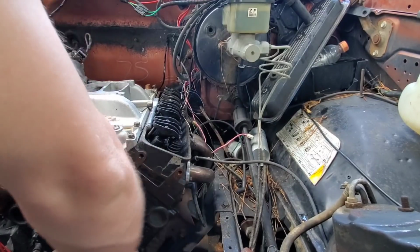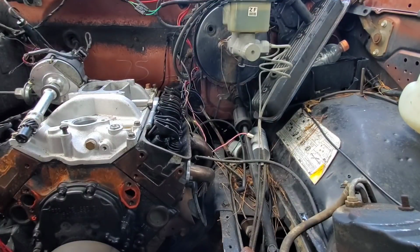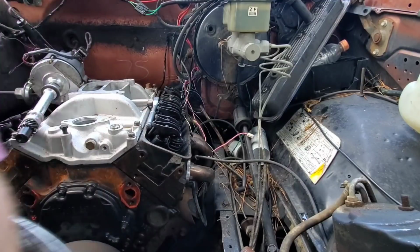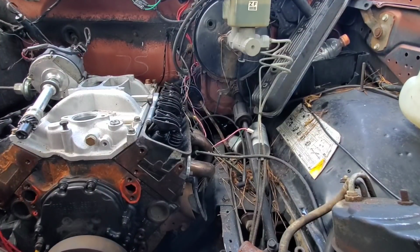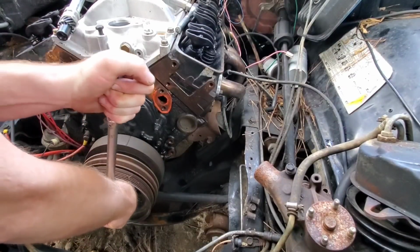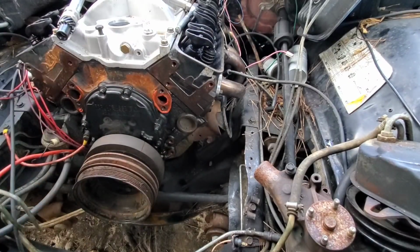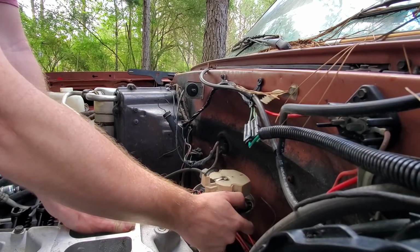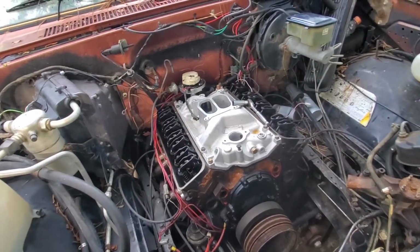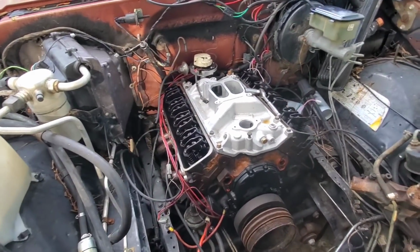Alright. Exhaust valve is starting to open. It's closing. The intake valve is opening, intake valve is closing. Now we roll it on over here. Our line lines up right there. Let me get these rockers adjusted, and then we'll figure out our carburetor situation.